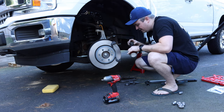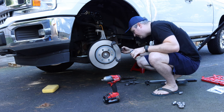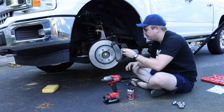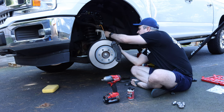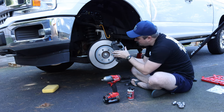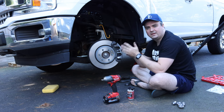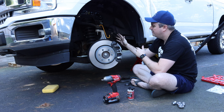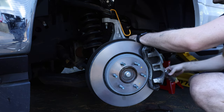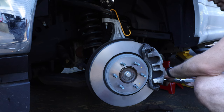With both of those bolts in, I'm going to go ahead and grease up the bracket contact areas without getting any on the rotor, and then put the brake pads in. Now that we have both pads on, I'm going to take the caliper and set it over the pads — it should just slide right over. With the kit from Ford, it also comes with new caliper pin screws, so I'm going to put those on too. Check your shop manual for the correct torque spec, as I found different numbers in different locations, so make sure you find what's correct for your application.